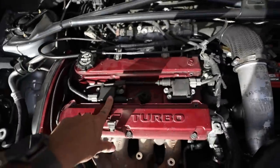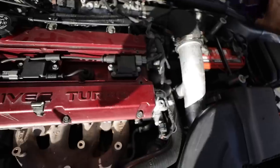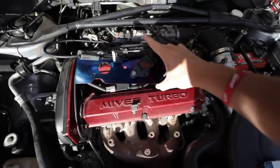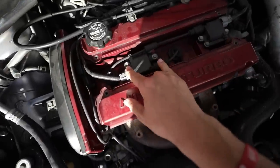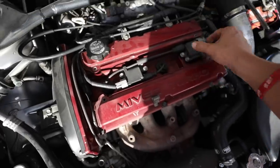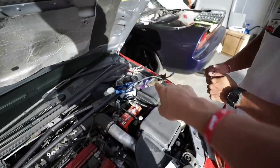And that's what it looks like without the valve cover. If we replace it, that's going to look so gnarly. I'm stoked. Once you've got the valve cover off, you just have some more 10s connecting the stock plugs onto the motor. Unbolt all of these 10s, you can take out and unplug the stock coil packs, and then we can go ahead and install the new one.